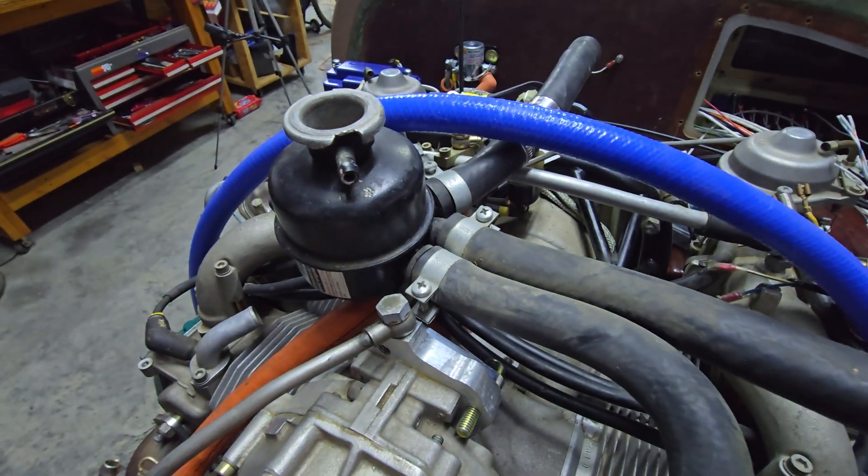From the blue color you can tell it's been installed. These are the spring clamps, and there's the spring that keeps this from kinking. The clamps underneath were a bear to get at — obviously you can remove the intake manifold, but it's doable with different angles and different tools. The heat shield is on, the rear cylinders are done, and I've also installed a new oil line — Parker tubing with heat shield as well. The next phase is getting the radiators back on and plumbed up.